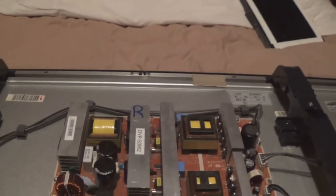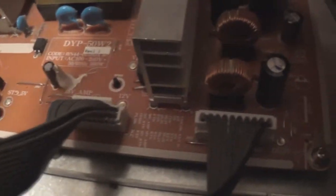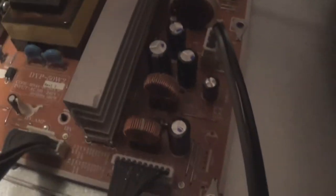There are a few options to power this fan. It's a 12 volt capable fan, but I don't want to run it at 12 volts because that's going to be too loud. The power supply has a 12 volt and a 5 volt rail at 5.3 volts. What I'll do is apply 12 volts to the positive pin of the fan and apply 5.3 volts to the negative pin. What that will do is run the fan at 7 or 6.7 volts. So applying 12 volts to the positive and 5.3 volts to the negative makes it a 7 volt fan technically - that will be a lot quieter and still move a good amount of air.